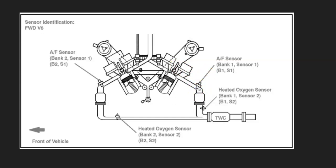For example, here's a 2007 Camry 3.5 liter V6, and as you can see, bank one, sensor one is right here. It's always a good idea to get a diagram where everything's laid out if you can — it just makes things easier. But if you find the number one cylinder, that's bank one, and the first sensor going down is sensor one.